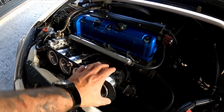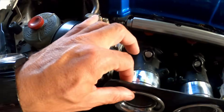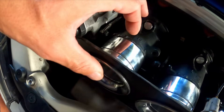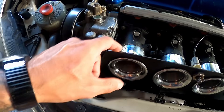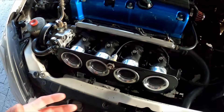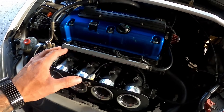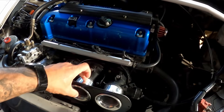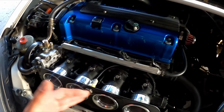These are custom rams that I made. They were originally that big where that slit is, and they slid onto here with a little bit of silicone. I extended them for a little bit more gain on the torque side and throttle response, because I did put cams and they made the motor a little bit lazy. I extended them so we get a bit of response low down, and I don't think it affects much up top.